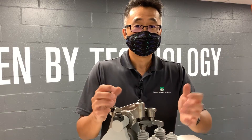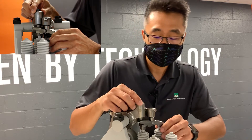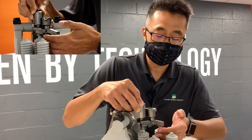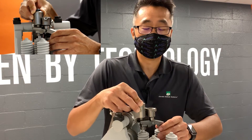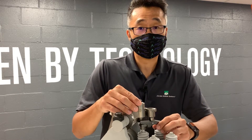Through the use of our patented Fulcrum technology, during the braking event exerted by the brake rocker, the force exerted onto the braking valve — some of that force is directed back up into the hydraulic lash adjuster, preventing pump-up and taking up the gap that would occur in a conventional lash system.